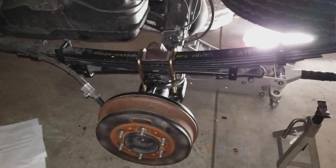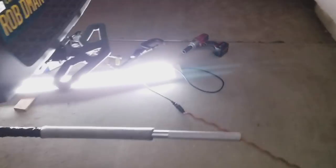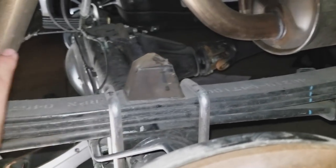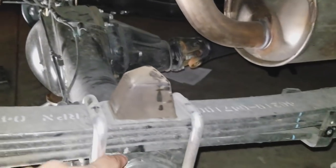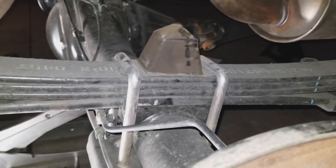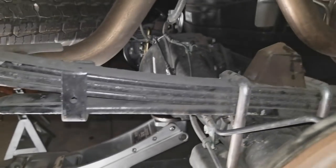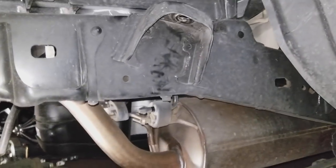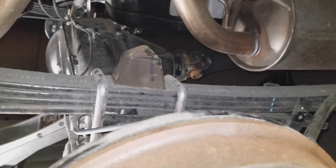Alright, I got this one together — it was a pain in the butt. So I'm hoping I can get this other one done. I'm going to be burning them in that oil as they say. What the problem is — it's not really a problem — but you got to take this off. This comes off, the bolt comes off, you use a c-clamp loosening this up, but there's a big bolt that goes here which is kind of difficult to fit the longer bolt from the outer leaf. So I had to kind of finagle it. I already grinded down the retainer earlier so I could clear it.